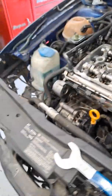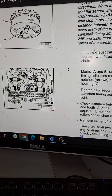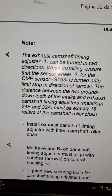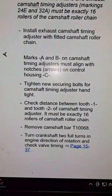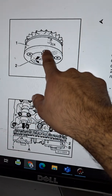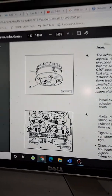This is what the book says to do — I have all the books here and the information on the computer telling me exactly how to adjust it. You can pause the video to read the wording. You've got to make sure that the wheel here is clockwise all the way, and the way you achieve that is once everything is timed, you rotate the cam clockwise until it maxes out. I hope this helps.